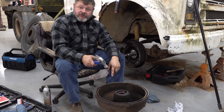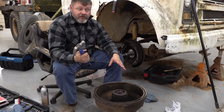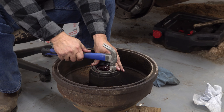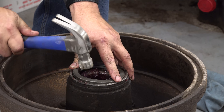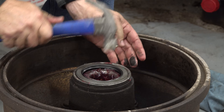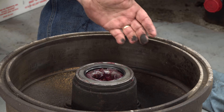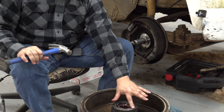There is a seal installer but I don't have nothing this big, so this is how we used to do it out in the field. You just find the pivot point — there's an art to it, it's a skill you learn. You always want to hit flat face too so you're not denting the top of your seals.